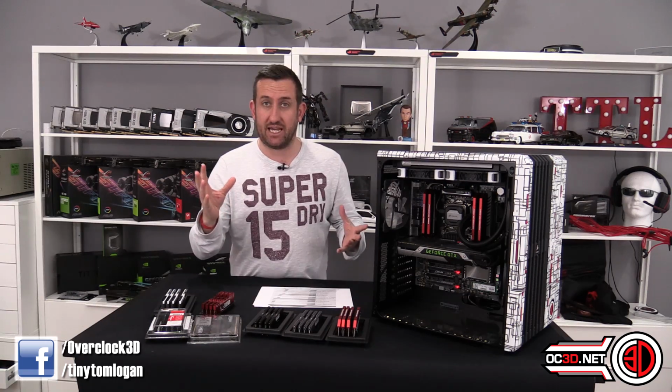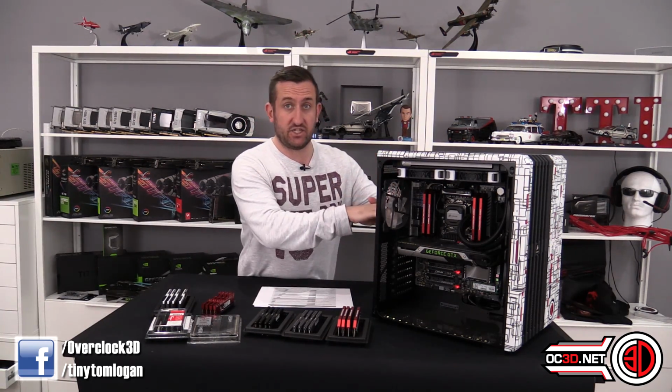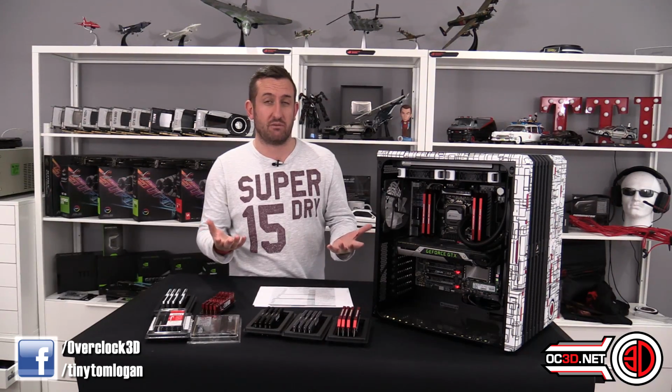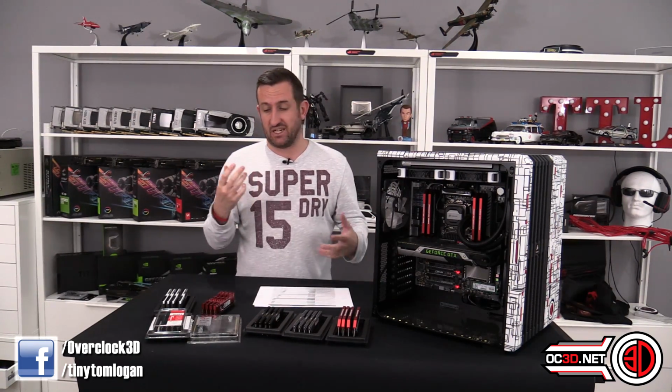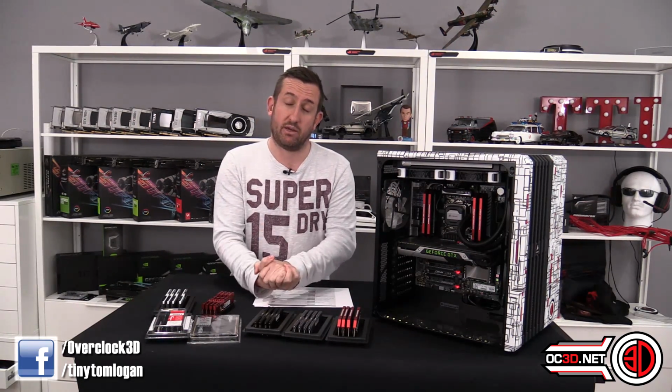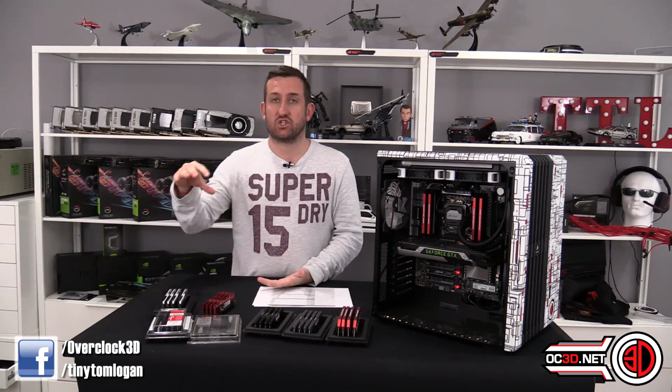So just to clear up as well, in case people are thinking, oh my God, is 10 GBE going to make my internet faster? To those of us into networking, it sounds like a comical kind of, maybe even trolly question, but I do get asked it a lot, especially the difference between certain gigabit Ethernet, let alone 10 GB. No, it's not going to make your internet faster. That's all down to your connection with your ISP, your internet provider, quality of your line, all that sort of stuff. 10 GB on this is really to do with network transfers depending on the network that you're connected to.